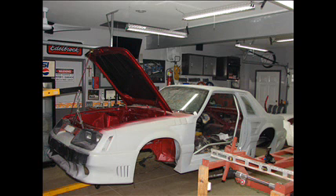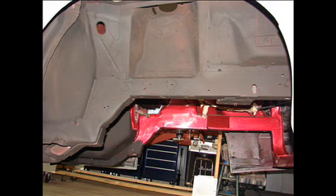The first thing to do is remove the front suspension by unbolting the K-member and the struts from the top of the shock towers. You should be able to pull that front end right out of there and you'll have a nice clean slate to start with.